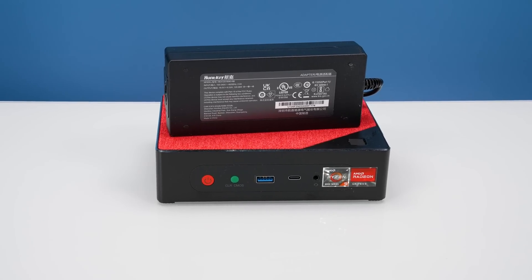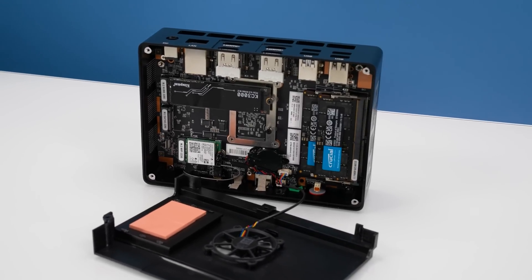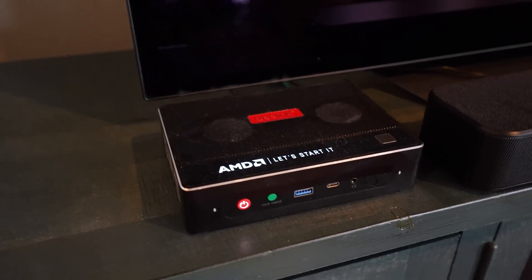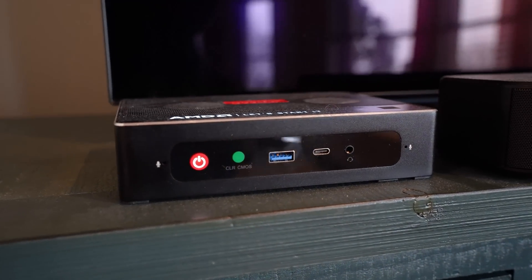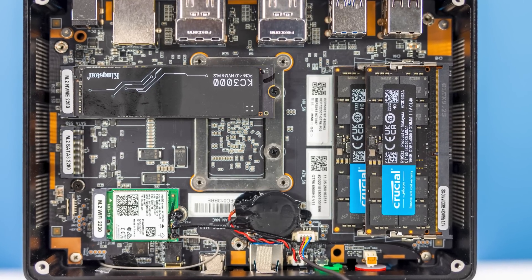The second key lesson learned is the power consumption side. We hit a max peak of somewhere around 75 watts and didn't really get much higher than that. Given that it's larger and has two fans — one cooling the bottom, one cooling the top — I was hoping this would be a very quiet unit, and frankly it wasn't. This might actually be louder than the GTR5. The GTR5, sitting at about 10 feet away, is just on the cusp of being too loud. If Beelink made this a slightly larger chassis but got it to a sub-30 dBA solution, I think that would be much better. This thing really could be silent, and I wish it was.